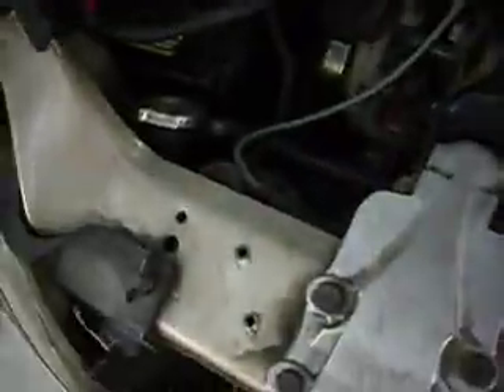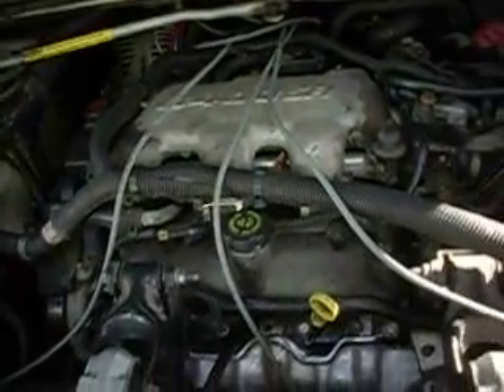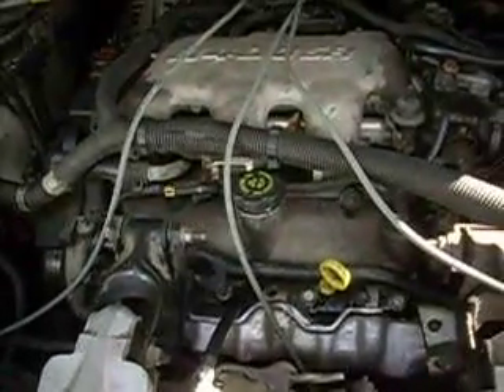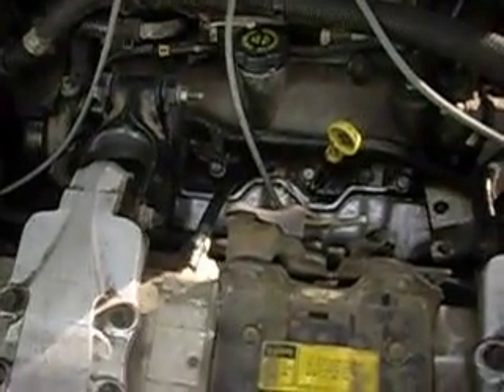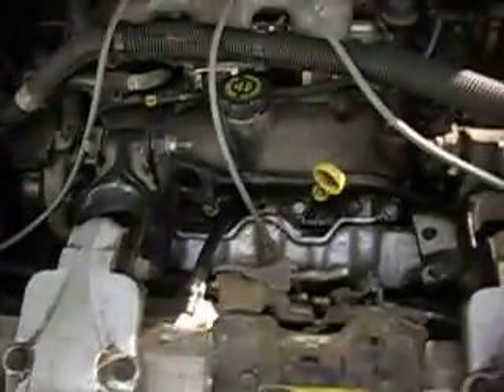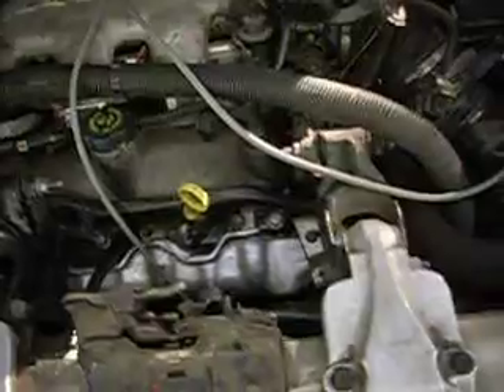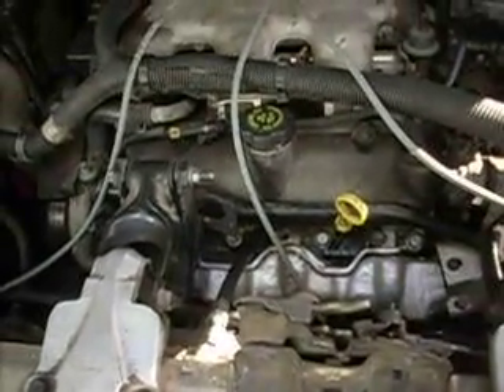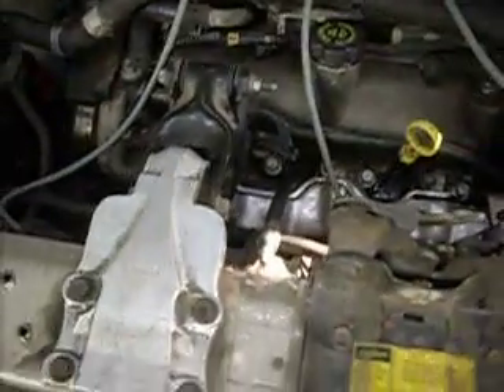I started checking one thing or another. I didn't think it was an ignition problem because I'm getting spark. You can see I've got the spark plugs out here on this head. I haven't done anything on the other head because of the inaccessibility — you literally have to rotate the whole engine, which I think I already mentioned in the last video. After doing a compression test on this side of the engine, I had profoundly low compression: like 60 psi on number two, nothing on number four, and like 70 or 75 on number six. Not good at all — the center cylinder is dead.